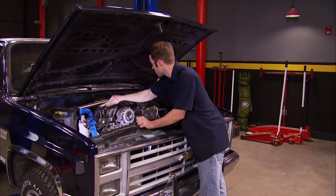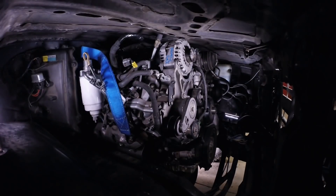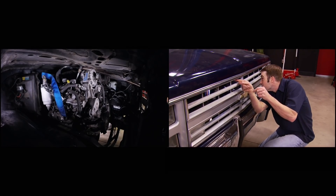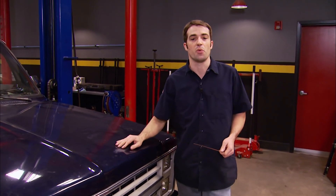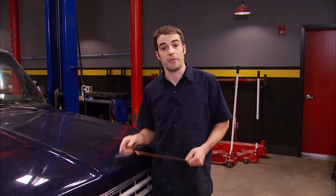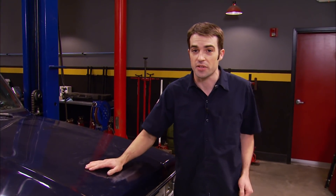Time for the moment of truth. And it looks like the hood barely clears — we've got a little bit of room over top of the alternator and this fitting. But if we wanted to run the stock hood, we could just cut another half inch or so out of the engine mounts, lower the engine down that much, and we'd be gold. This hood needs some paintwork and we want to run a cowl hood for the more aggressive looks. But if you did this engine swap, kept the stock hood and the stock ride height, you'd have one heck of a sleeper on your hands.